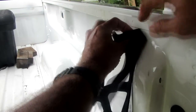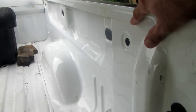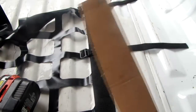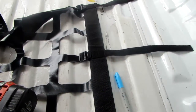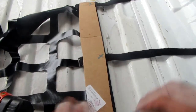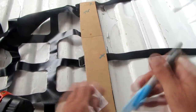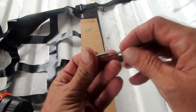If I take it all the way to the top of the truck bed there's about an inch and a half to two inches between the net and the deck. So I'm going to put it just below that seam and just inside that little lump. I'm no good at measuring so I like to cut things out and mark them. I cut out this piece of cardboard, lay it right on the net, and mark it exactly where I need to put the net mounts. I'll write 'top' up there so I don't put it on upside down.